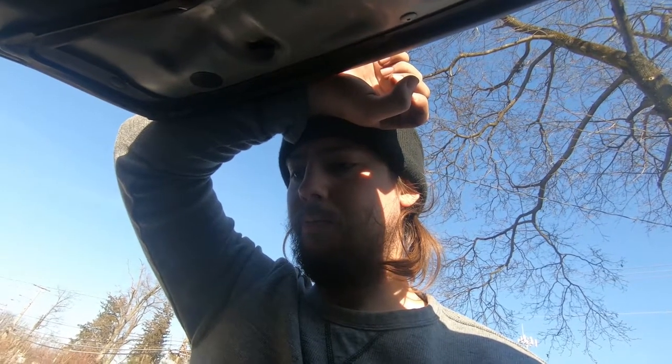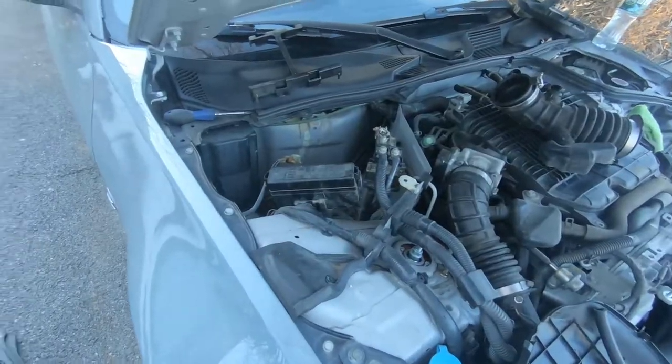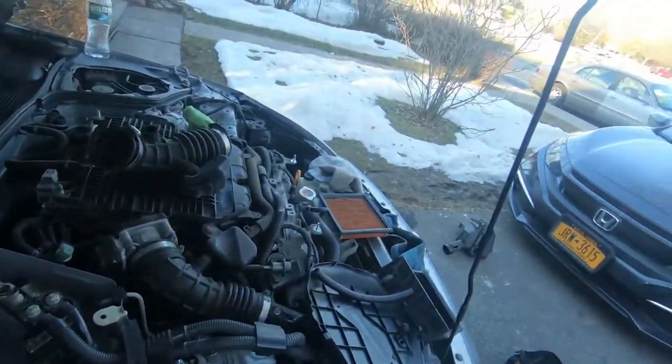So just gonna move forward with the spark plugs. I wasn't planning for the intake boot to have a rip in it. That actually makes the whole situation better because I'm getting misfires, and that might be why. So I'm just gonna try to clean out a lot of the engine today.